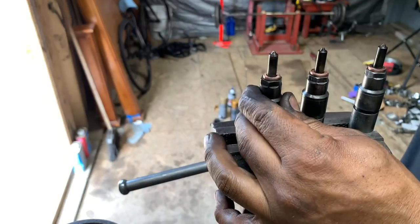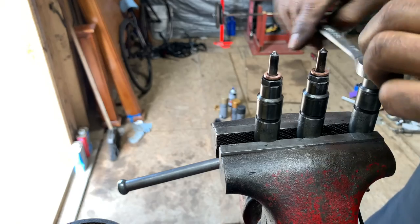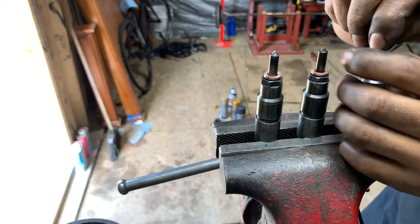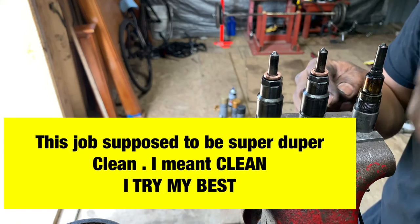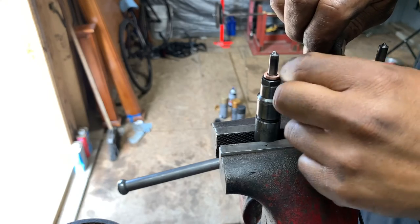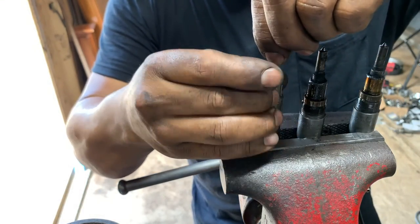You're just gonna hit the tip like this, like that. You're doing that so you can lower the tip down, so that the tip doesn't spin with the nut together, so it stays on the injector. Otherwise this will be connected to this piece because of the carbon built into it. So there's one. Okay, there's two. I try not to mix all the tips or the nuts.